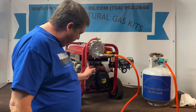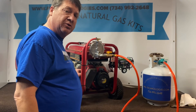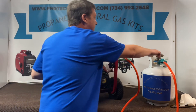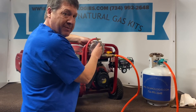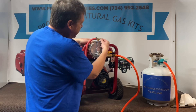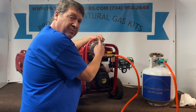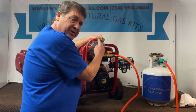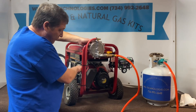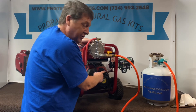Now what we're going to do is get this started. Make sure that you have your gasoline shut-off valve off, and make sure you run all the fuel out of it. Even when it runs out, pull the choke — you can normally get it to start again because there's a little bit of gas left. Run that out also. Now go ahead and turn on our propane, make sure our valve's on. On the back of this unit there's a manual primer button — hit that for one or two seconds while you're cranking. That'll give you a burst of fuel coming into your carburetor. This is your main adjustment — the power elbow. In is lean, out is rich. This is a very sensitive setup and most people's problems. Once you get that set and lock it down, you don't have to go through this again. Leave it loose so you can adjust it. Make sure your switch is on run — this one's got electric start, so go ahead and hit your button.